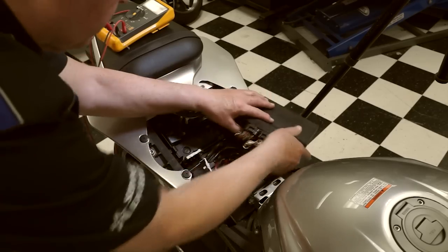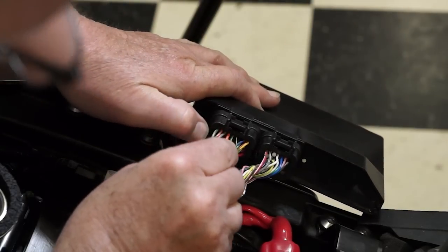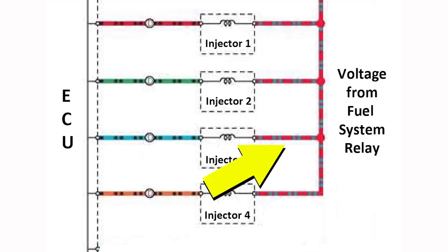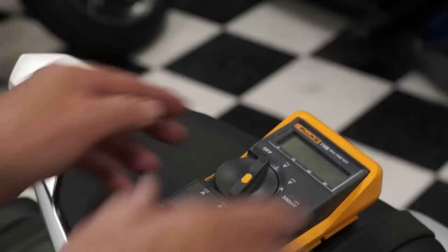Start by connecting to the ground side of the injector, which is real easy to do by back probing right at the ECU multi-connector. You won't even need to remove or raise the fuel tank to test here — just remove the seat on most models. The power side is a parallel connection to all the fuel injectors, but the ground side is a single wire from each injector to the ECU. Refer to the appropriate service manual wiring schematic for the ground wire color code for each injector.